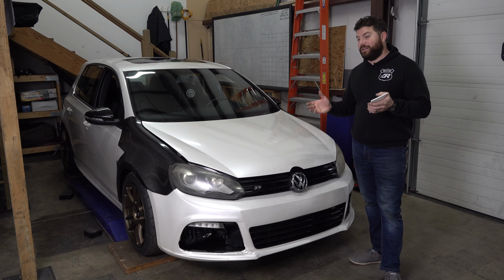You'll see here shortly what's going on there. But I ended up ordering a simple manual boost controller for that. We're going to run that in parallel with the N75 valve. I don't even know if the N75 valve is functioning or not. We don't have any codes for it. But again, I don't have the tuning software for the custom tune, and my goal is to start all over after this trip, or maybe after Wookiees, and start fresh with products and tuning all from the same company, and just know what's going on instead of dealing with a bunch of custom stuff with somebody I've never worked with before. I'm not educated in that area anyway, so I have a lot of learning to do. But like I said, we're going to run that manual boost controller and at least limit the upper level of boost, and we should be good to go.